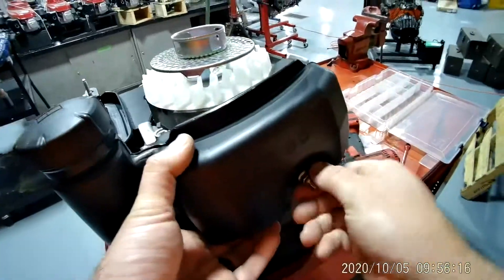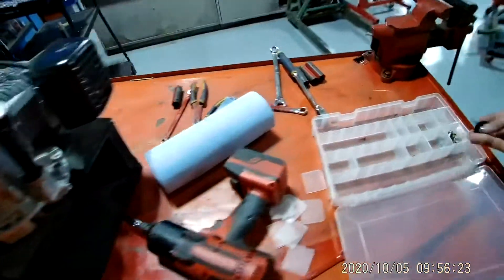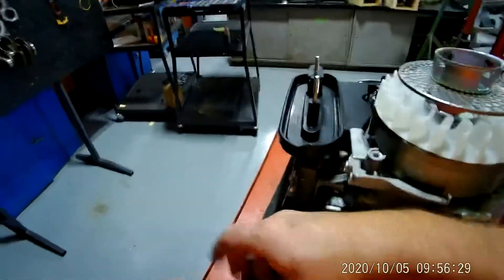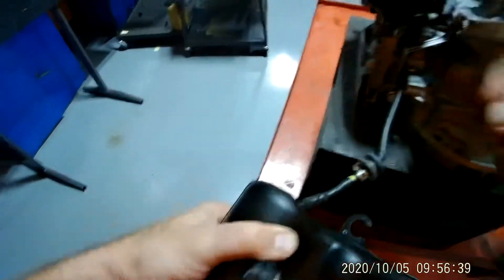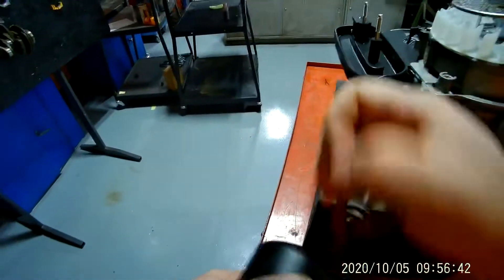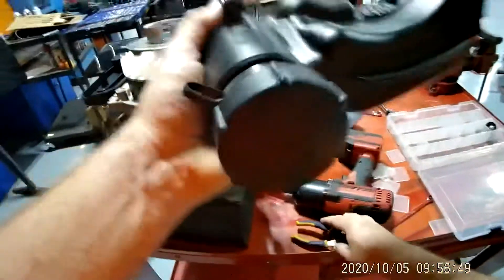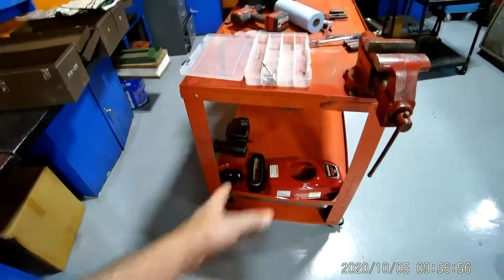Let's get this fuel tank off. That bolt is already undone, and this right here is a 12mm. Get out your 12mm wrench or socket, fit it on there, loosen that up, and spin this off the back here. Get yourself a pair of slip joint pliers. Of course this thing wants to stick on there pretty good — just be careful and wiggle it on and off. This is the fuel tank; we're going to sit it right there. That is the next thing I took off.